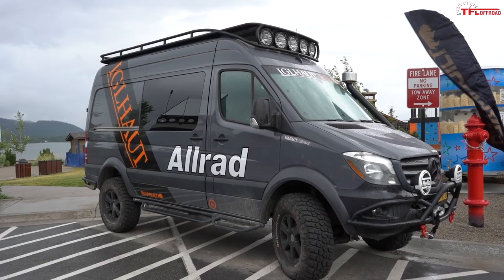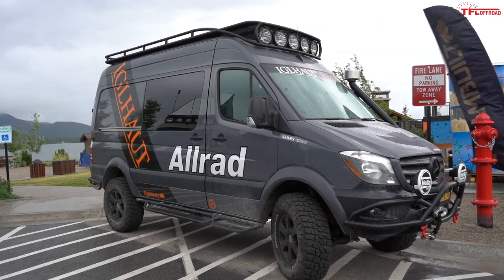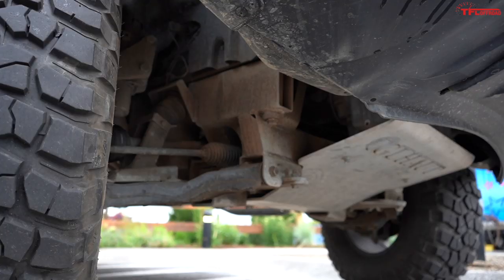This is a true old-school 4x4, off-road capable system. You buy a two-wheel drive Sprinter anywhere in North America, then they handle all the logistics as the US partner. The two-wheel drive gets shipped to Germany for conversion, because of quality control and expertise. The process takes about six months and then the vehicle comes back and you get the ultimate off-road van. You lose none of the on-road performance — you choose the tire size, the entire system is calibrated and re-geared for that tire size, so it accelerates and handles like a Sprinter.